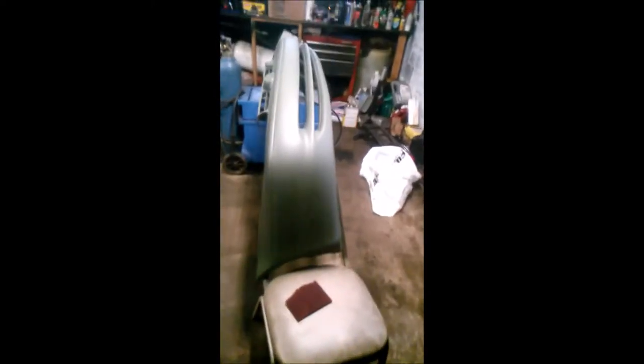Get ready to lay the final coat, the third coat, on the bumper. This is what we've got so far with two fairly thin coats. It's almost covered, but not quite. You can still see a few spots or a few light areas. But we're going to lay this last coat, and you should get complete coverage with a final coat. After I get this final coat done, you'll want to let this dry for about half an hour, and then you'll want to scuff it again or hit it with like a 400 grit sandpaper. I typically just scuff it with my pad. Comes out great. And that's just to clean everything off and promote adhesion of the paint, the base coat. There we go, final coat.